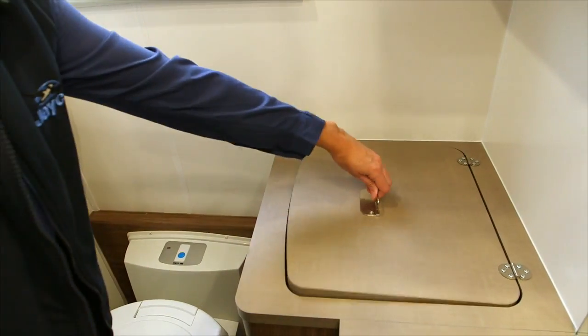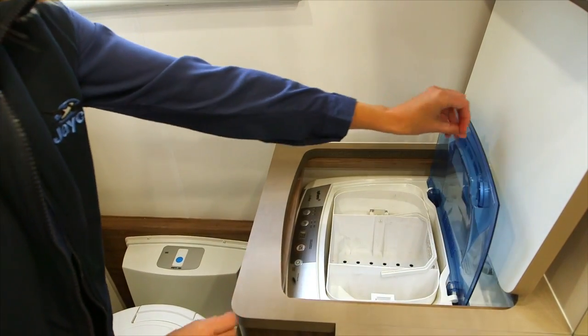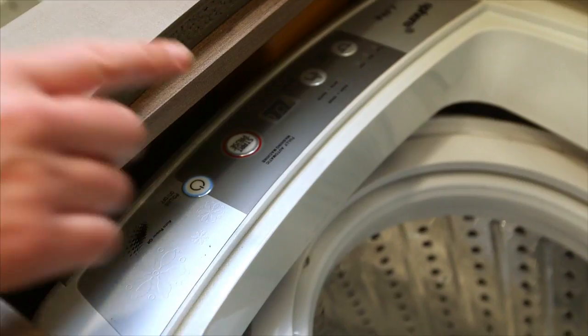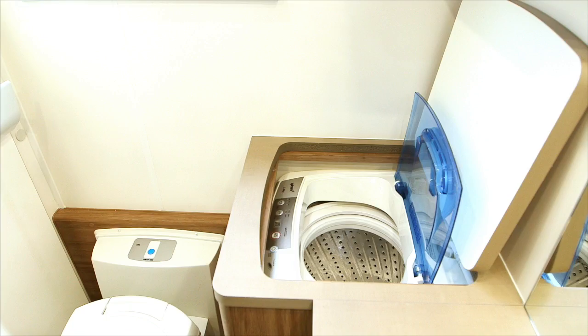The Sphere 3 kg washing machine has 5 processes, from a wash-rinse spin cycle lasting approximately 38 minutes to a simple spin cycle lasting approximately 7 minutes. Wash settings are set via the control panel. To wash clothes, select the proper water level according to the quantity of clothes. Select the programs and process. Close the lid and press the Start/Pause button. For more information, refer to your washing machine operation manual.